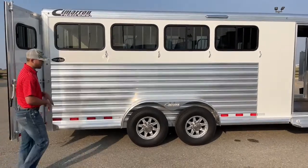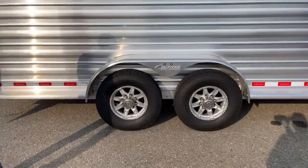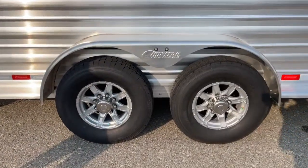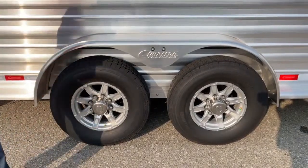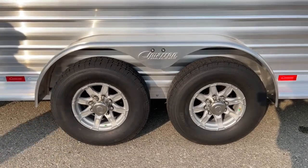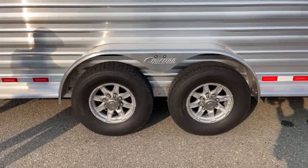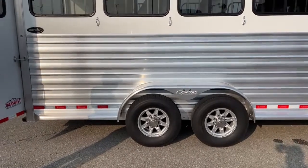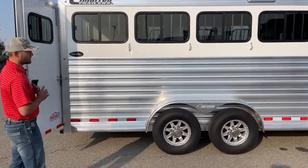Down here, the wheels and tires match the spare up front, so they're 100% matching. This trailer runs on two 7,000-pound Dexter rubber torsion axles, giving you a really top-notch axle system. The tires are also nitrogen-filled — you can see that green tab right there. On a crisp morning going into a warm afternoon, you're not going to see that 4-5 PSI fluctuation you'd normally get, so you don't have to keep hopping in and out of the truck to check and adjust tires.